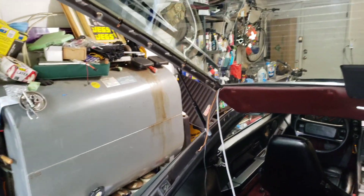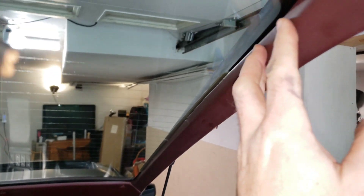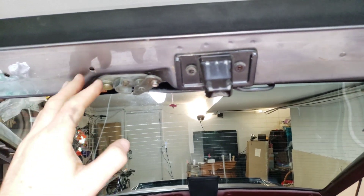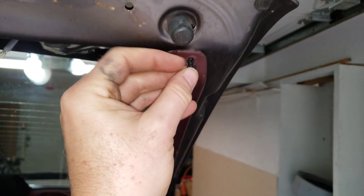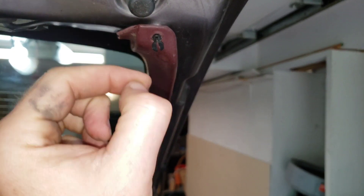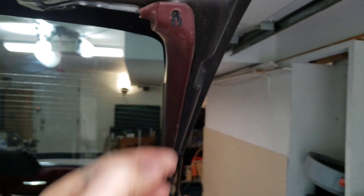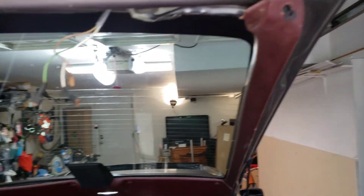I'm sharing a little bit about what I learned about taking some of the rear hatch trim off the 928. This is a piece that's still installed — this is the piece I'm referring to. I've already taken off this aft piece, which is really just a matter of backing out center pins that are in this particular trim fastener. The fastener goes in there, there's a little cap on it and you just basically pull that back and away or pry it up with a screwdriver and it releases the tension. But in terms of taking these pieces off, a little more finesse is required, so I thought I'd show you why.